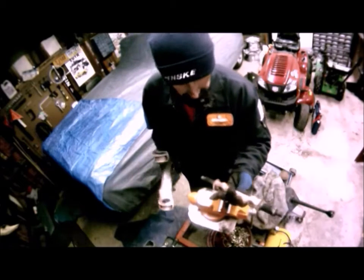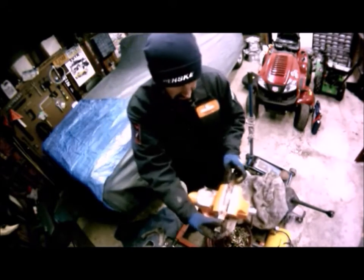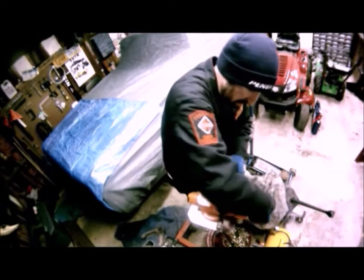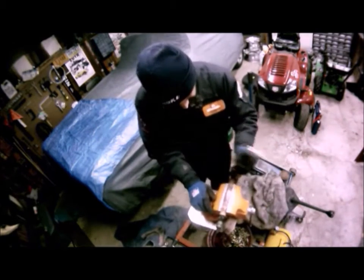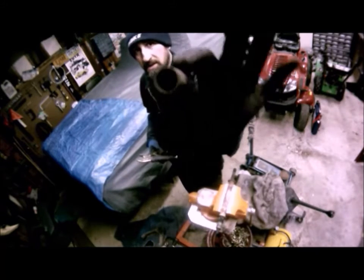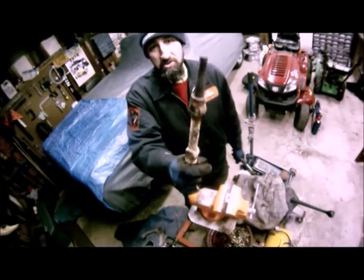The spindle is out, so now all I've got to do is lock the spindle back into the vise and grab the centers of the bushings - or what's left of them - and just slide them off. A pair of pliers will probably do the trick. The centers of the bushings are just sliding off. You want to make sure you get this out because the new bushings do not use these. That is how you disassemble a control arm.